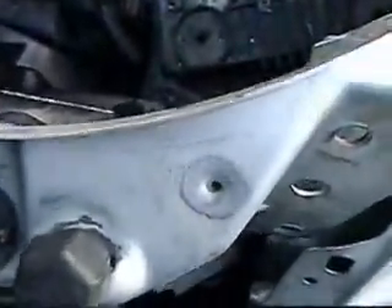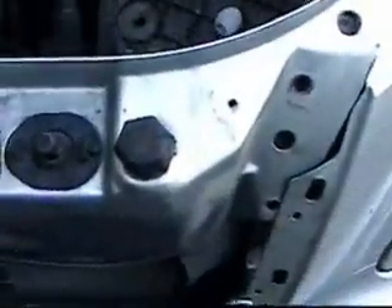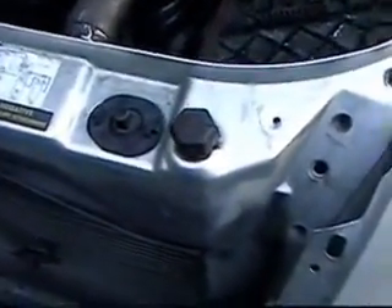The cooling fan is installed and mounted — it's a made-in-Taiwan unit from eBay Motors. Reinstalled all the radiator hoses and the front cross member. Basically it's a reversal of the removal procedure. You can see the six bolts — three on each side — mounted up. Then put the grille back on after you get the cross member in.